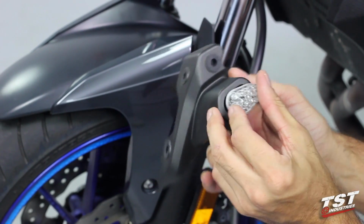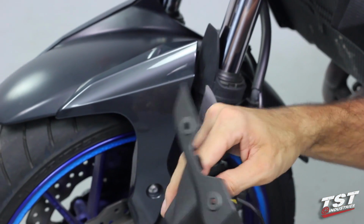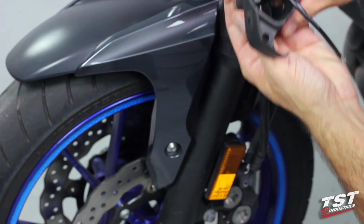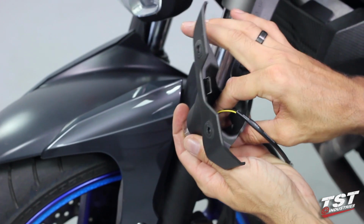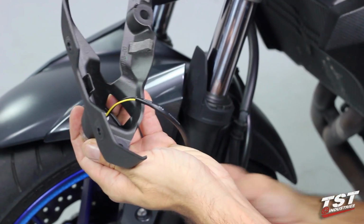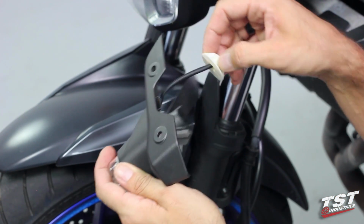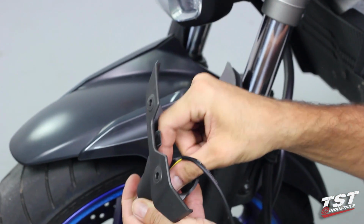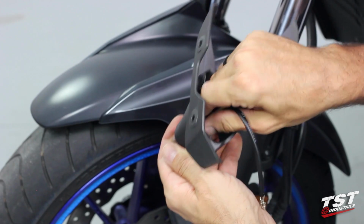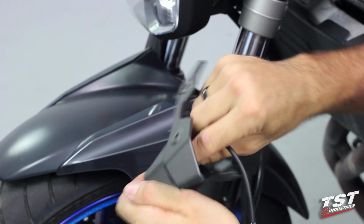All right, so I will arrange the signals from the outside with the flow of the geometry that they mount into, and on the inside I will have the spacer arranged like this, pretty much just jamming it in place. And now I will put the nut onto the wires of the signals here, flange first, and this will enable me to actually turn this nut down onto the stud protruding from the back of the signal. Now we will have these assembled onto the shroud.